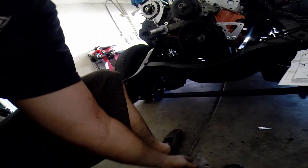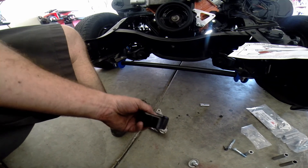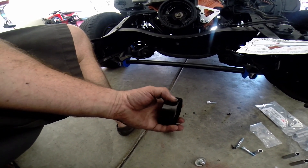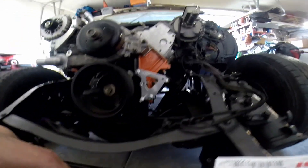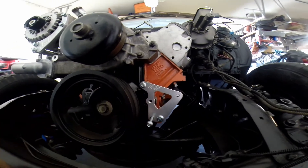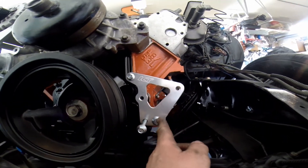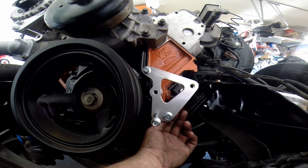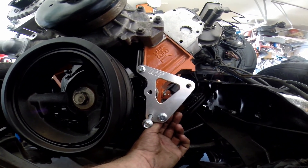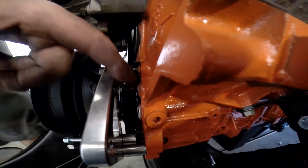You're going to use your old tensioner, take the old pulley off, and they give you a new tensioner pulley — it's smooth, not grooved, similar to the water pump. You're going to discard two front valve cover bolts. You'll use an M10 by 60mm bolt, a 110 spacer, and there are also two 70-thou spacers.